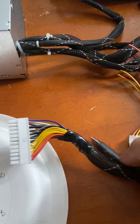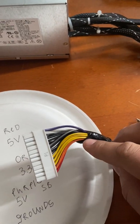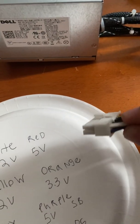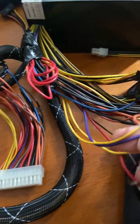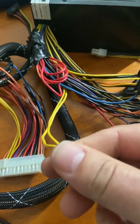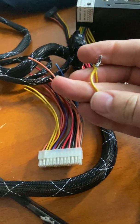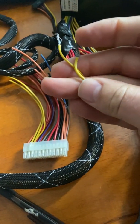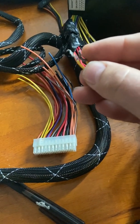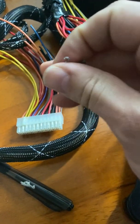You're gonna cut this harness off and put all the oranges with the oranges on the ATX power supply. Wire the two whites together with the yellows. Make sure the ATX power supply you get has yellows, because you're gonna need at least two or three yellows. Hook up those five yellows from the Dell PSU plug to the yellow wires, and wire the white wires and yellow wires all together — you need those five yellows to make it run.